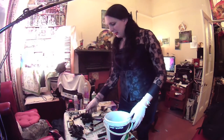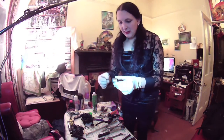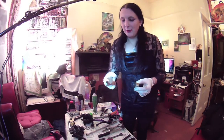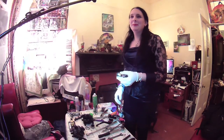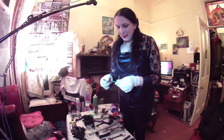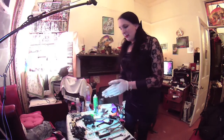Now with the pistons, this ring of dirt and corrosion needs to be taken off. I use very fine wire wool, and that brings them up looking like that. There's still a little bit of corrosion on there - here's one I prepared earlier. I'm going to clean that off with some wire wool. I've also got this second pin - this one wasn't stuck in like the other one was, it just slid straight out, but there's still some corrosion on there. I'm going to clean that off with some wire wool as well, and then coat it with ACF 50 before I reassemble it.